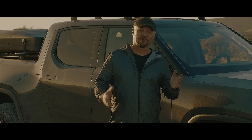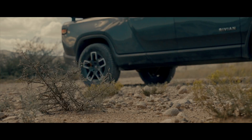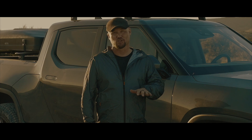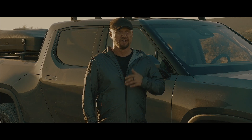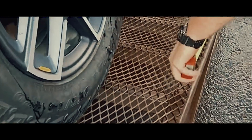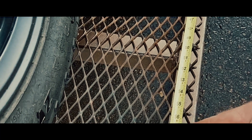Let's go through the pros and the cons. The pros: it is a high-performance machine — just under three and a half seconds zero to 60, 850 horsepower, four motors. You can lower it into sport mode and it handles like a sports car. Off-road, it has nearly a 34-inch tall tire and 15 inches of ground clearance. We put it on the RTI ramp and got nearly 500, which is better than most stock internal combustion vehicles.